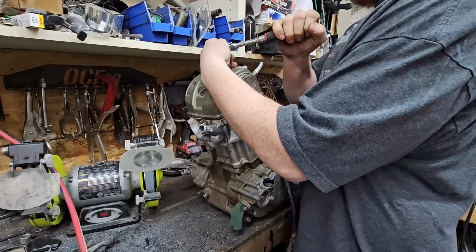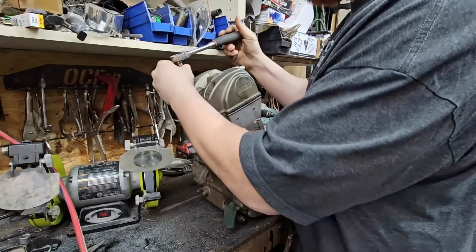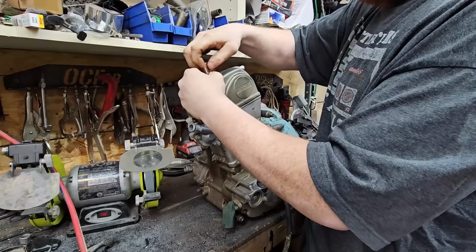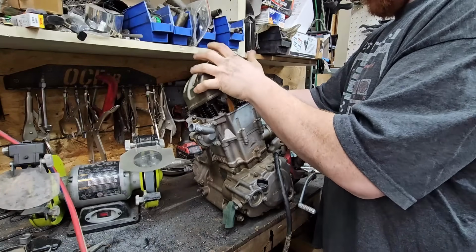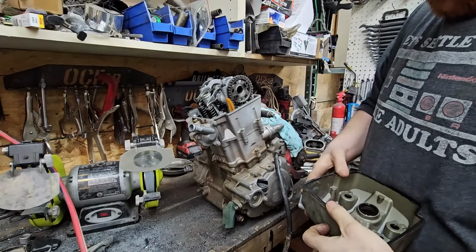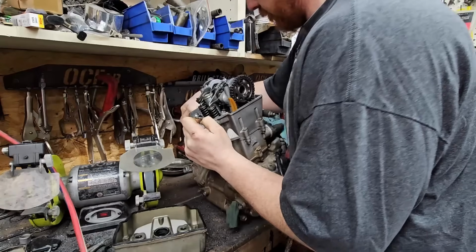Let's take a good quick look at this motor and make sure she's going to breathe some life into this chassis again. I'm gonna start by checking the valve clearances. These Honda 450Rs have a much different cam design than most other comparable race machines, with a singular camshaft that Honda named the Unicam. It's one single camshaft with bucket and shim style adjusters for the intake valves, and then a rocker arm with a tappet adjuster for the exhaust valves.